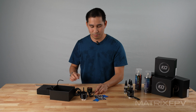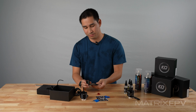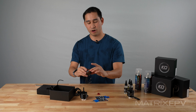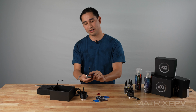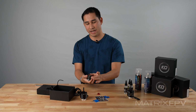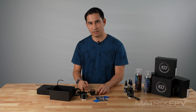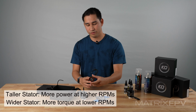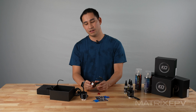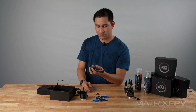And the reason why I bring this up is because in the e-skate world, sometimes the motors aren't accurately advertised in terms of stator height. They partly include maybe the bottom part and some other stuff to get the stator height. But no, the stator height needs to be exactly this visible green stuff, as well as the diameter, not fudged numbers. An interesting thing about the stator height, which is 25 millimeters: most popular X-Class motors would be maybe 15 and a little bit wider. So a good one would be a 42-15.